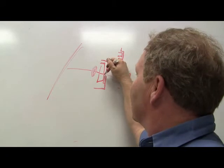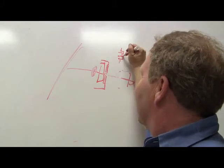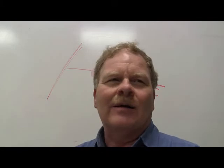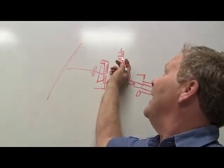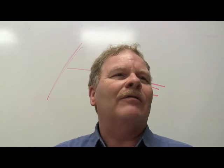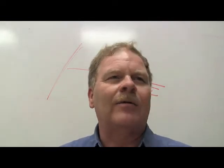The base of this thing was sitting in that little spinning drum. As this little part would get a little wear, some little particles of copper would fall in there. It was a tiny little thing, as little as a straight pin. It would fall in there and start grabbing that needle shaft, and that needle would go whap, whap, whap, whap. And a speedometer for one of those cars was $500. It was real expensive, by the time you did the labor and everything.